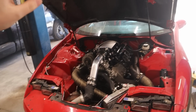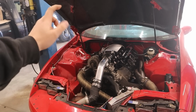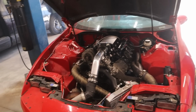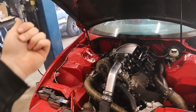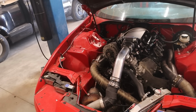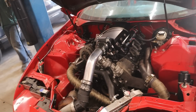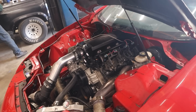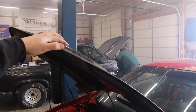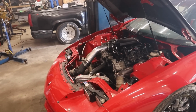So sometimes you can command, let's say 900, and the set screw down here will be off, so it won't be able to go that low or it won't be able to get that high. But we had that great. Put it on the TRANSBRAKE. Immediately started puffing white smoke, lifting a head gasket. So, not great, but they can fix it, and it still starts kind of not great. Also, pops over here, fixing a fuel line leak on Jack, trying to get that thing sorted. Anyway, once that's fixed, we can play with the tune some more.